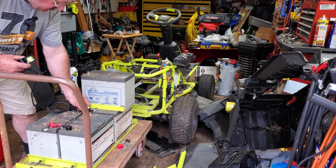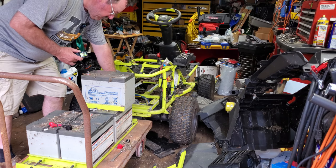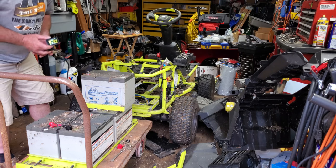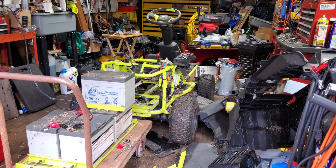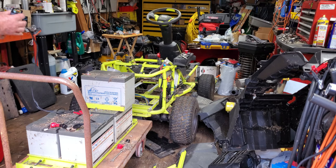So now we will move to the next battery. They all read about the same — they're all bad according to the amp-hour rating at 75. So just for the heck of it, we're going to manipulate a couple of things here. We're going to test at a different amp-hour setting. Maybe I'm not testing the right setting — I'm testing amp-hours because that's the measurement on the side of the battery.